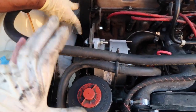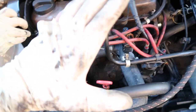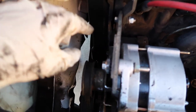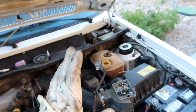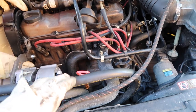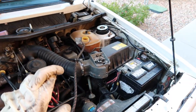We just finished up — we believe we are done. The alternator is back in, the hoses from the radiator, everything is put back in. The distributor cap is put back on, the air conditioner compressor, the alternator — all those cables and pulleys are back together. The battery is now tightened. We are going to put antifreeze in there because last video you guys saw it was leaking everywhere. Let's put antifreeze in there before we start the car back up — fingers crossed.